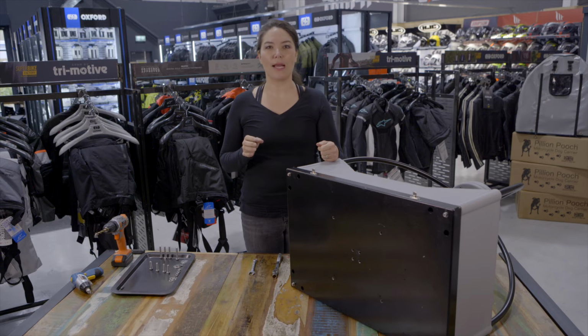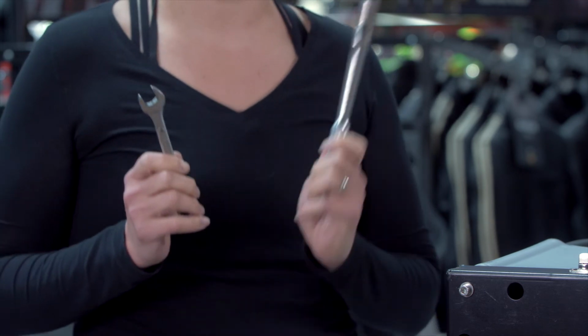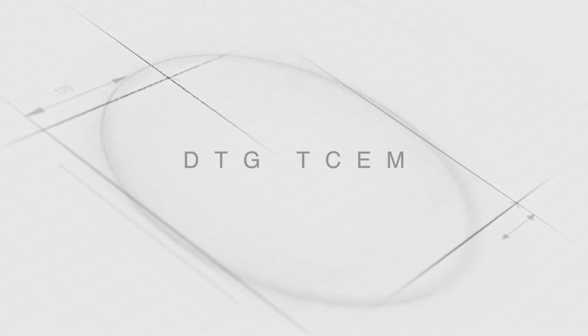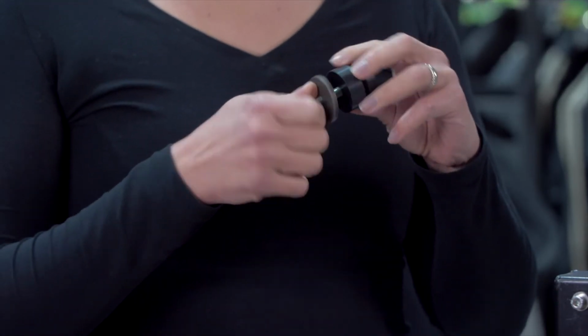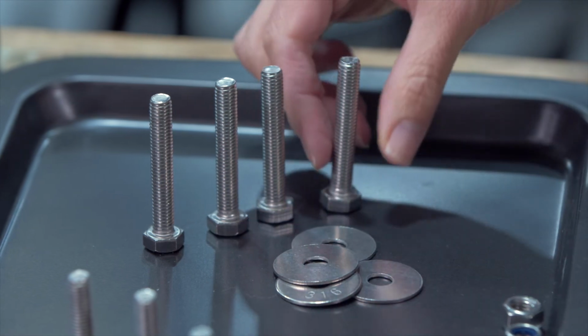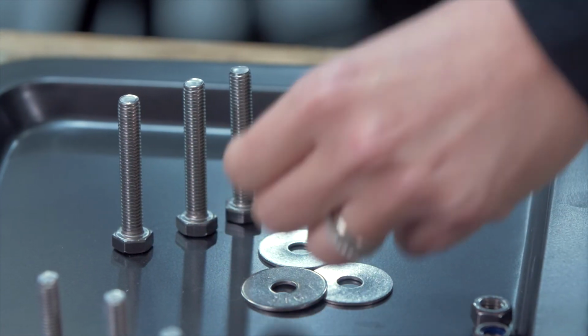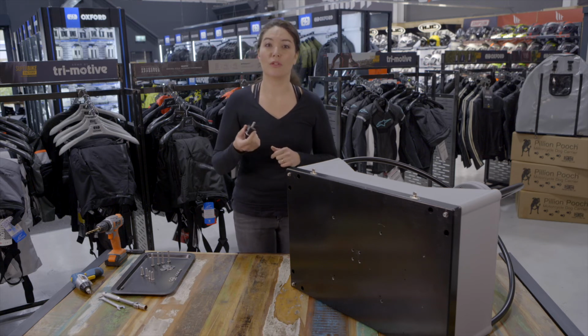We'll cover the BRE rack and Torpack rack in this video, and for both of those you'll need 2 13mm spanners or sockets. If it's the BRE rack you've chosen, then we are going to be installing these pucks. And what we'll be doing is slightly different to the BRE manual. We'll be removing the screws they provide in the puck and using the 50mm M8 bolts we provided with the penny washers on them. So we screw the bolts into the puck and then place the bolt through the holes we drilled earlier.